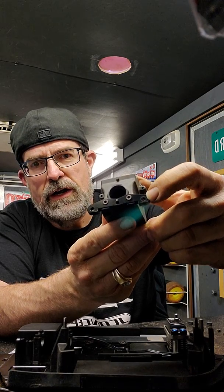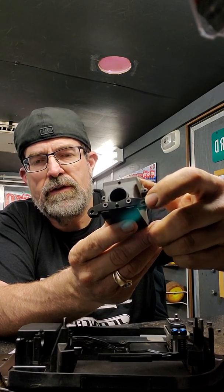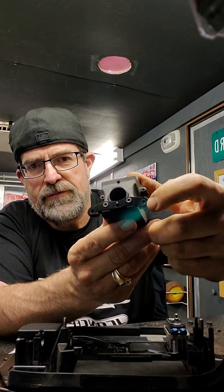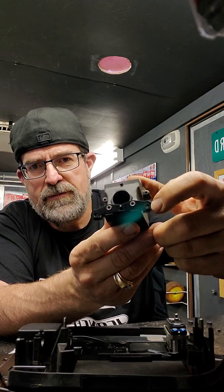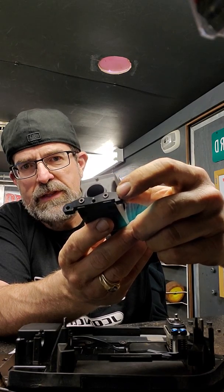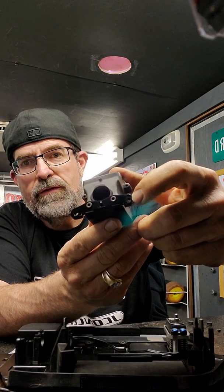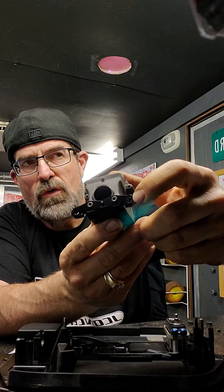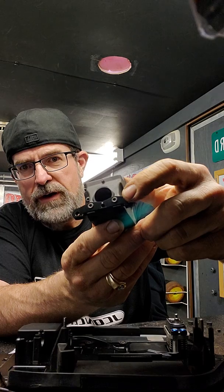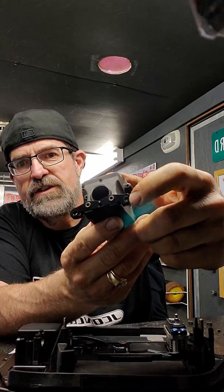The two dot raises that position 0.7 millimeters. The one dot comes in the e-buggy and is at its lowest position. The two dot comes in the 819, which is plus 0.7 millimeter. The three dot came in the 817 nitro buggy at plus 1.4 millimeters, or another degree. They skip a four dot for some reason, and there's a five dot, which came with the 817 truck — it raises at 2.8 millimeters.